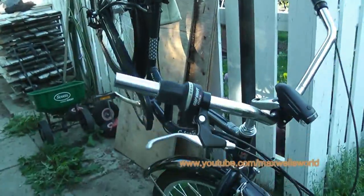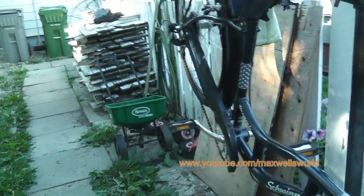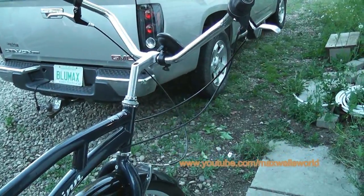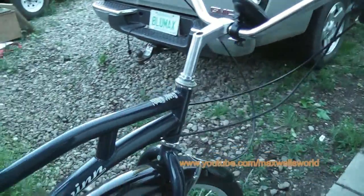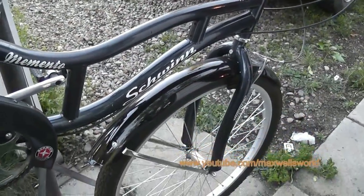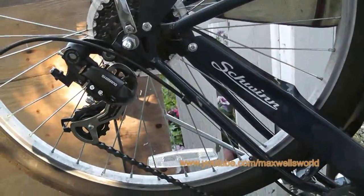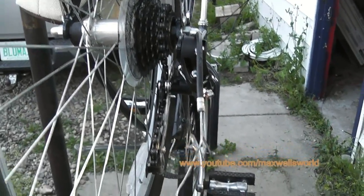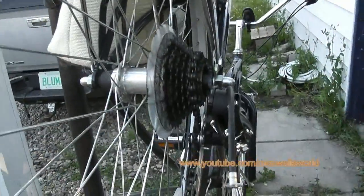The temperature has cooled down and I'm still working with the injured hand — you've probably noticed the band-aid and rubber glove. I had to take off the rubber glove because it kept getting caught in places it shouldn't. I tried to use the twist shift provided by the customer, but couldn't make it work, so I had to reuse the old derailleur cable since the new ones were too short. Right now I'm ready to set the limit screws — first the outer limit so the chain doesn't drop off the outside, then the inner limit so it doesn't jump off the inside edge.